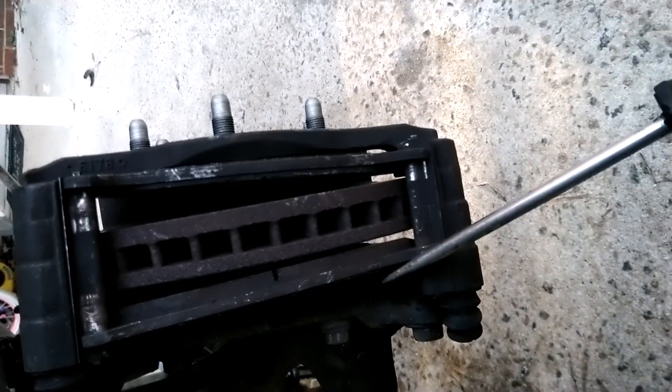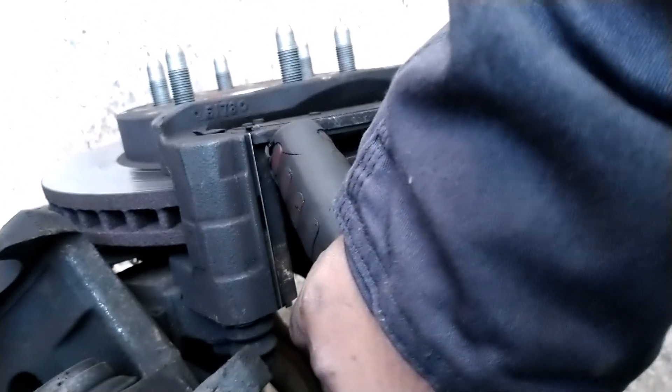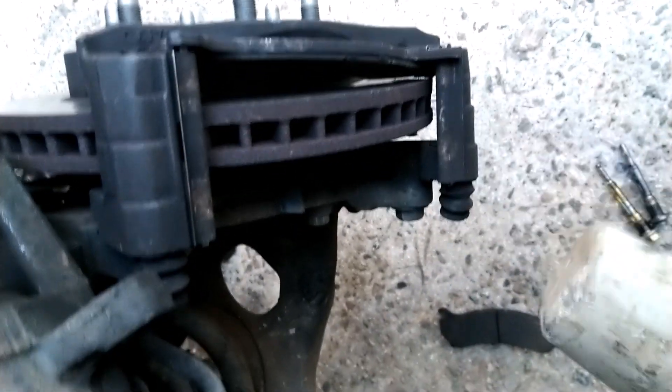These are what stop your car. They're very easy to remove — they're just sitting right here. There's one on this side and another one on the other side; just pry them out. This is the rotor and these are the brake pads. They're just held by the caliper, but now the caliper is loose so you can just hit them out. Sometimes they come off by themselves, but they've been sitting there a long time with all that heat. Just get something and knock them out.